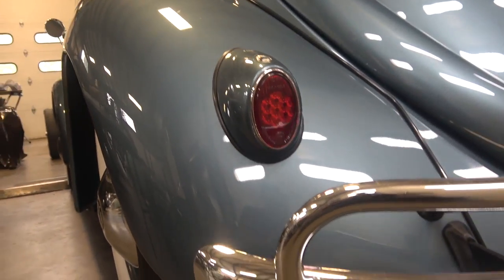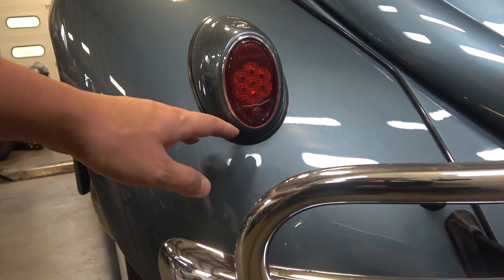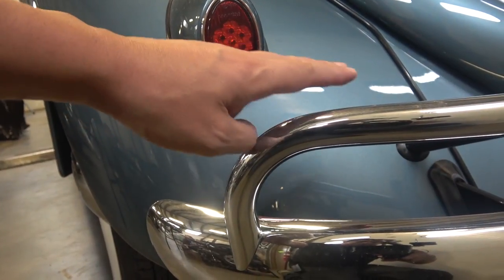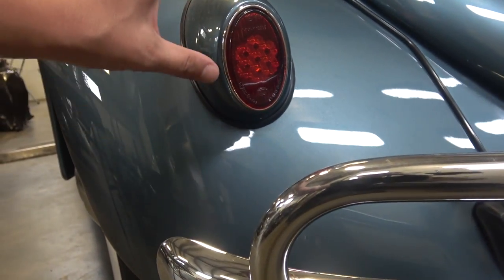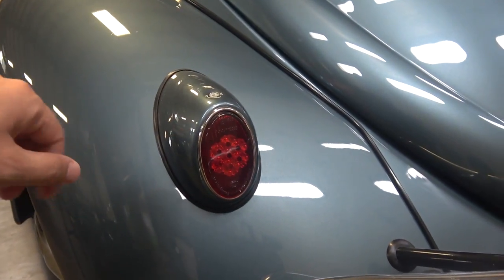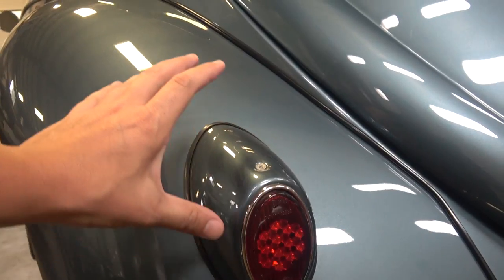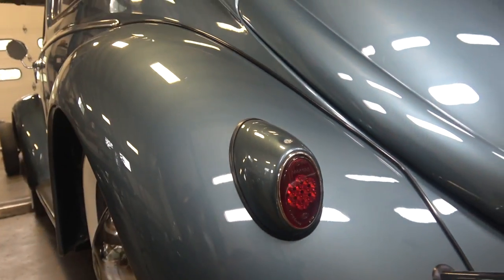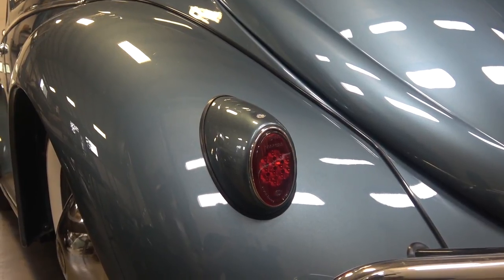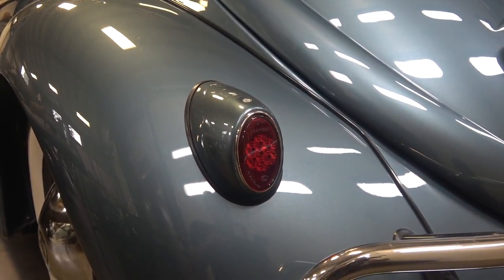When you come down level with this, the word of mouth going around is that the bottom of the tail light goes straight across to the overrider bar on the bumper, and that's a good indication you're at a good height. But if you use the later holes or the aftermarket holes from the new fender, the tail light is placed much higher, and to many VW purists it looks kind of funny.